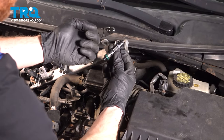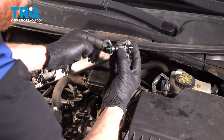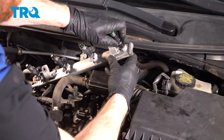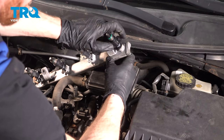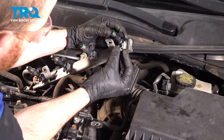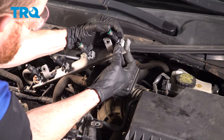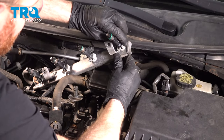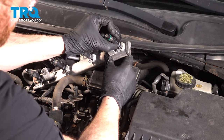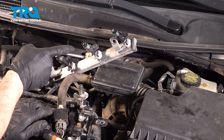Let's get ready for installation of our brand new fuel injector. We'll take a thin amount of oil and come right around each one of the O-rings. Once you have these lubricated, apply the side closest to the wiring harness connector into the fuel rail, making sure the connector is facing in the same direction as all others. Align your two locating tabs and reinstall your metal clip. To install the clip, find the groove in the fuel injector itself and slide the clip through it on both sides. Press it in as far as possible and make sure it's completely seated. Give it a little squeeze, then take hold of it and give it a wiggle — try to lift it up and out of position. If it falls out, the clip isn't in correctly. Continue doing the exact same thing to each and every fuel injector.